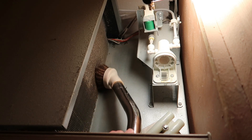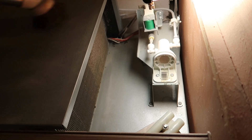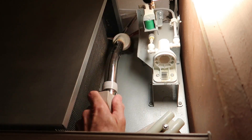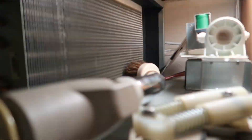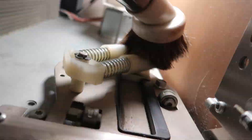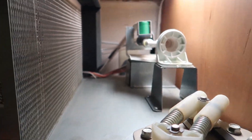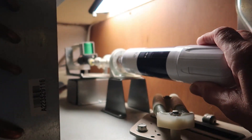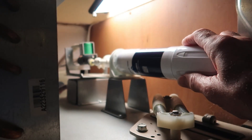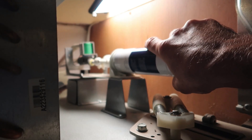Be careful not to damage anything. Those coils look brand new. Now we'll put the water filter in — I wet the O-rings with water before putting it in. We're going to rotate it, push it in, and turn it until it locks. Don't over-tighten it. And there you go — water filter is in.